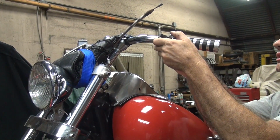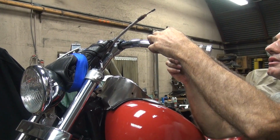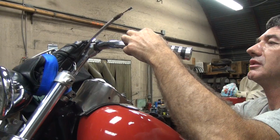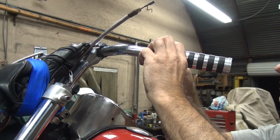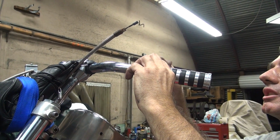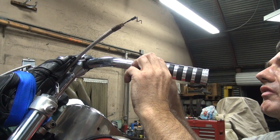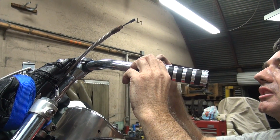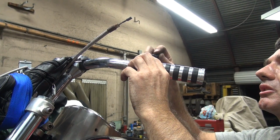I have a working clutch. I don't know what to do. Working shifter. Yep, that too. That goes with a clutch. Jeez. Wonder if the throttle works. Probably not. I wouldn't touch it. Can't believe how much of a dog this would have been. The motor's already got no compression, so I bet you this thing's only got like a 90-pound cylinder pressure.